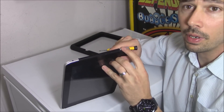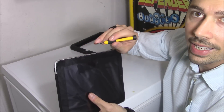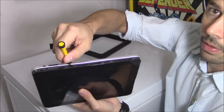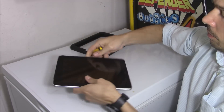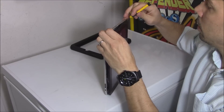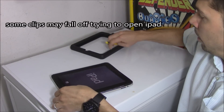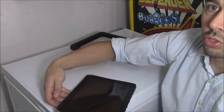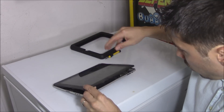Don't go where the buttons are — if you see a button or a volume rocker anywhere, don't put your flathead screwdriver there. There's a tab right next to it, and you want to put the screwdriver between each tab. If a couple of tabs fall off, don't worry. Also, don't put your flathead screwdriver where the home button is — it will damage the home button.